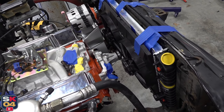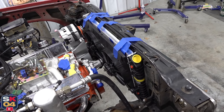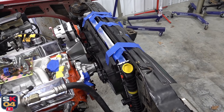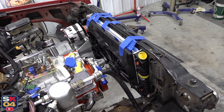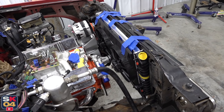I also have a C4 Corvette aluminum radiator, and what I'm going to have to do — even though I was able to clear up a lot of space with that water pump — the radiator needs to go further into the core support. I'm also going to try to push the condenser further forward and see if I can squeeze out another inch, inch and a half or so, which should be just enough to clear the serpentine belt.